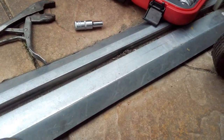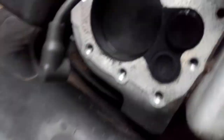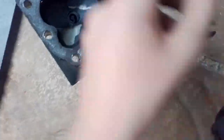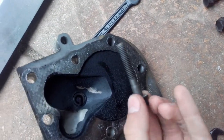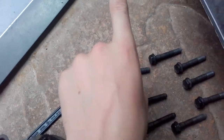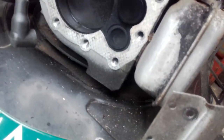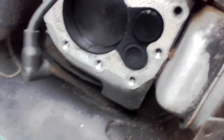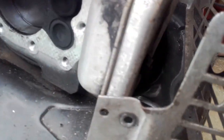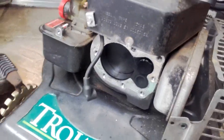If you look at the engine - that's a blooming big piston. I mean, this is a head gasket bolt, and look at it compared to my finger - it's quite a very big piston on it. The intake valve is open, but as you can see on both the exhaust valve and the intake valve, and the piston and the head, there is a lot of carbon built up. The cylinder wall from what I can see is very, very smooth and clean - I can't see any scoring or anything on it, which is more than I can say for the dirt bike.